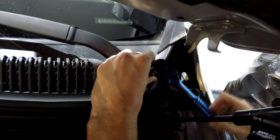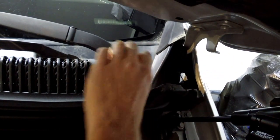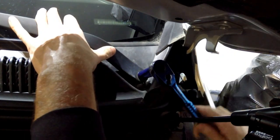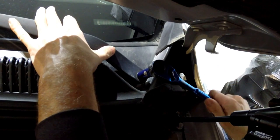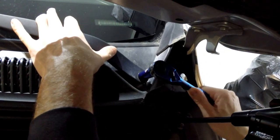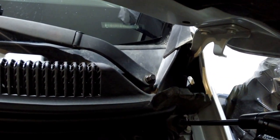Make sure that the arm is in the correct location. If it's too low it won't clear the windshield all the way up and it may hit the other blade. If you set it too high, it may actually pop off your windscreen and hit the side of your vehicle. Make sure it's in the proper spot before you start tightening it.